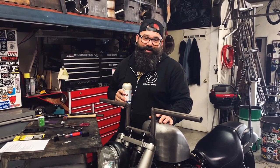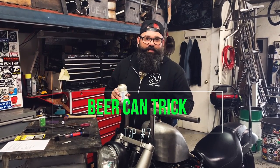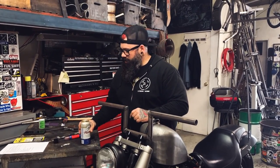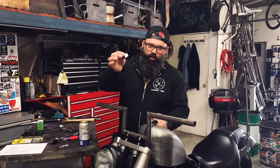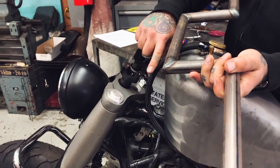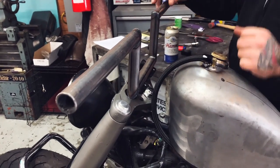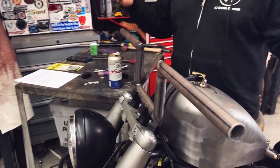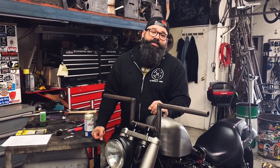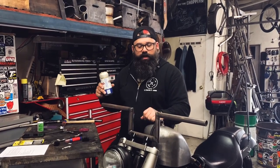Number seven on our list is beer can. You're going to take a beer can that you've actually finished, take the can and cut a small strip out of the aluminum. Just like with the aluminum wood screw strips, you stick it down here in your riser. The idea is to reduce the ID of the riser clamp to pinch down your bars tighter. Take that little piece of beer can, put it in, put the bars back in, and clamp the risers down. This is also one of those side-of-the-road shade tree fixes. Any old aluminum beer can will do — cut a strip, put it in your risers, and clamp the bars down.